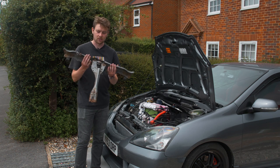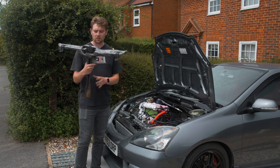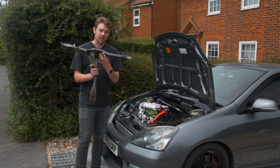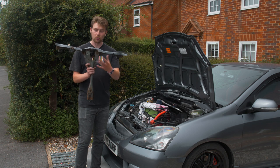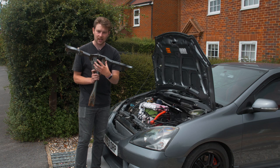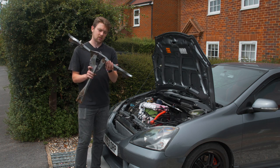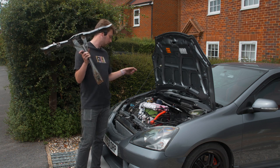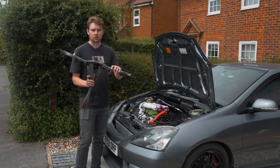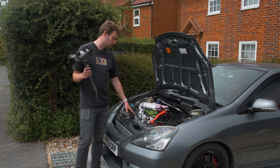This pre-cut piece came off a car with a Skunk2 already in it - I'm not going to use it because it's rustier than mine. From what we're looking at, I don't think it needs to be fully cut out - we're looking to hammer in this bit here instead. To get this piece out there's a bolt on the bottom and four bolts on top, and the thing should move around enough to make it easier to get the inlet manifold in.